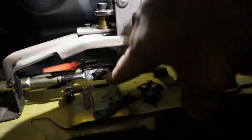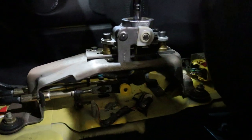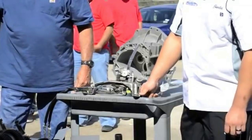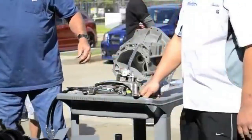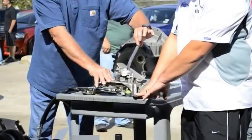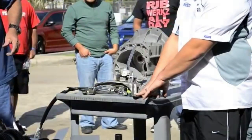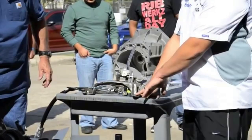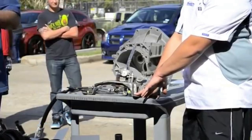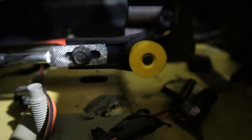The reason I popped this open is to check the crossover adjustment. I'll put in a clip from the Ed Peters Tech Talk that I've referenced before in one of my other SRT4 videos. You loosen up that bolt, grab the gear shift ball up top, and move the lever door to door — ever so slightly, not fore and aft. You'll see the change in where it was sitting. Mine didn't really move — it's an 8mm bolt — so it was already good. Just good to know it's right.